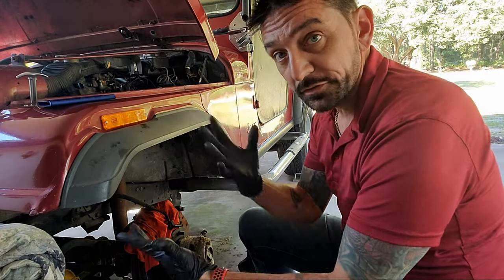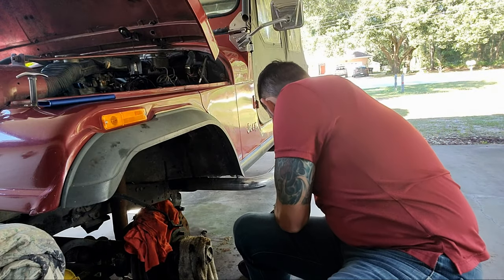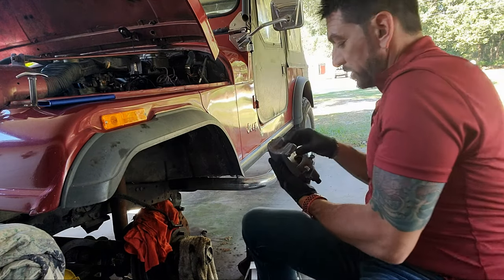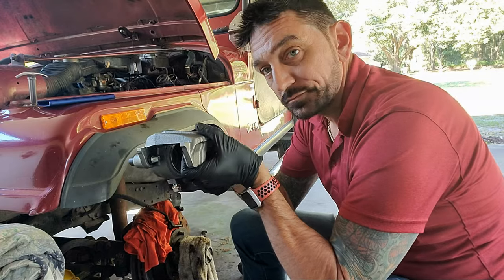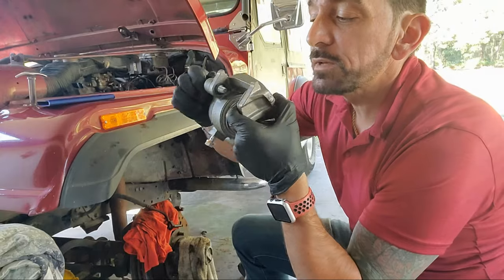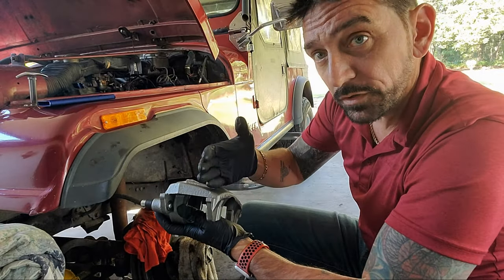And so when I went there, none of the brakes that are available for 1978 or 79 CJ7 are the ones I need. They all had the, there weren't bolts that go through them, like this. So this one has bolts that go through, and holds it on. So it mounts on the back side of the caliper, and bolts that go through the back. And none of them had this. So all of the ones that were shown for this vehicle were the kind that just had like the clips that clip on and hold this thing on.